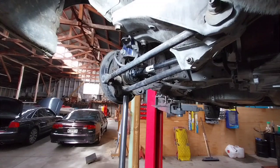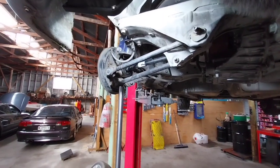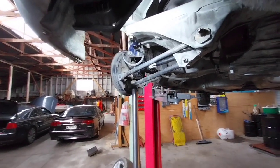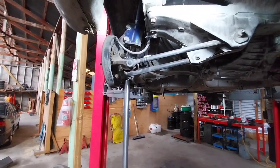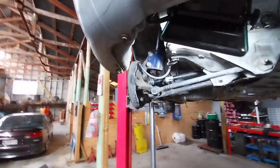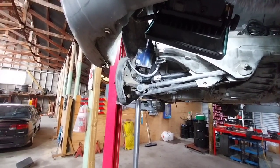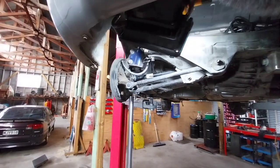I'll pull it all apart, strip this joint off, and take it down to my guy and get him to make me two axles the same. I need to check the axle on the other side - since I put the gearbox in the center of the car the two axles should be the same length, but I'll double check. Once he makes both axles the car will be axled up and ready to go. I'm glad I found a CV joint for the car that accepts a fat axle - for anybody doing a high-powered MRS or MR2 conversion, it's good to know that joint number so you don't have to worry about snapping anything.